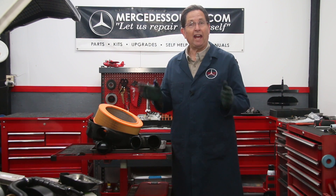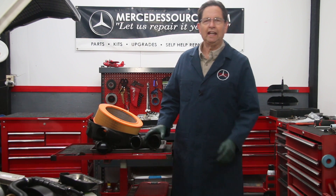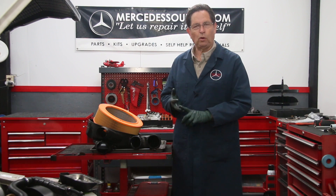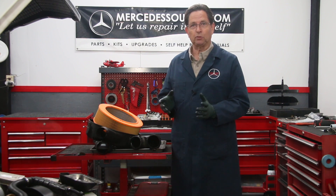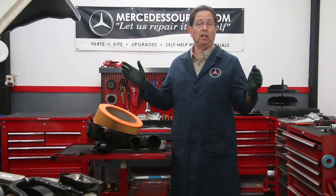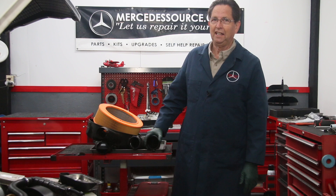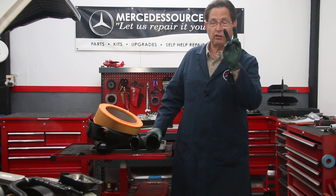These issues may not cause catastrophic failure but will cause typical problems you see with higher mileage diesels: excessive blow-by, low compression, excessive oil consumption, lots of engine smoke, and lack of power — because the piston rings wear prematurely. I have seen a number of these engines wear out at under 200,000 miles. You'll hear that these engines will go a million miles — no they won't, not if they're not maintained properly. You'll have a hard time reaching 300,000 miles if these two areas are neglected.